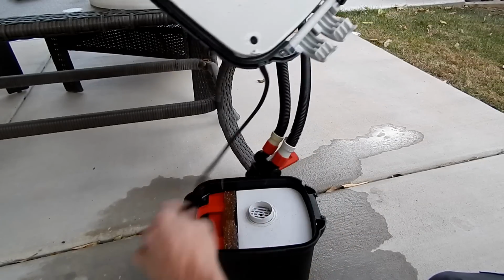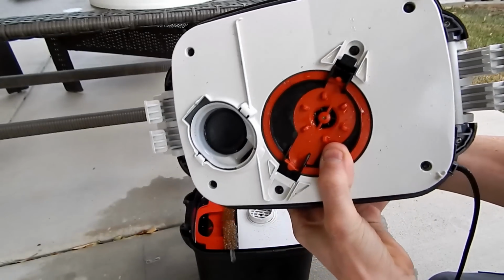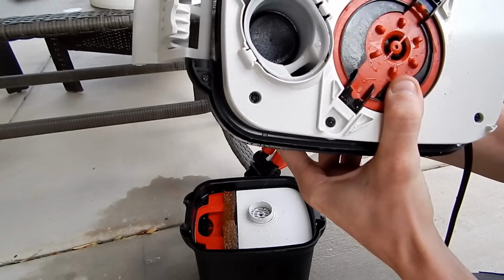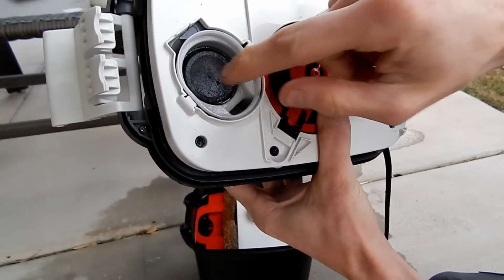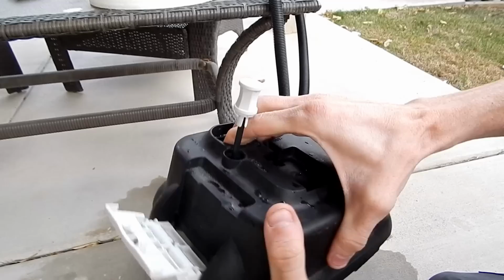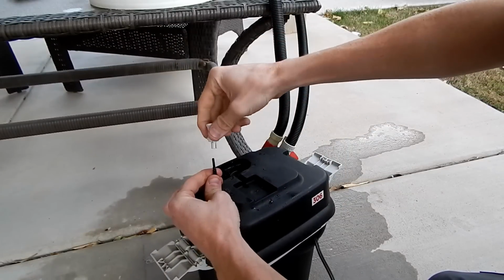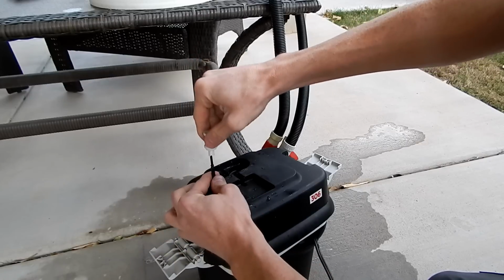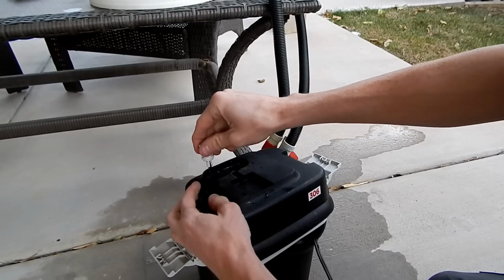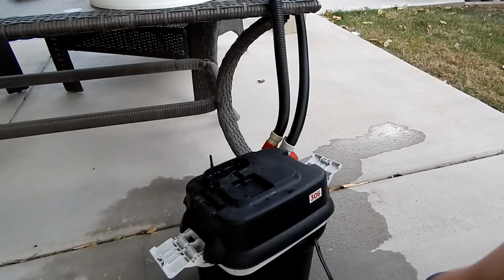I'm going to show you inside of the primer assembly. All it is, is a cylinder and a plastic piston. And that is it. I have taken this off before, or actually, let me show you how. Let's go all the way in. So with the knob, pull it up and very, very gently work it off of the shaft without breaking the shaft. So I find where the strip is there, or the slit, twist it just a little bit, kind of applying pressure that way, not the shaft itself, holding the shaft, but pushing this back a little bit, and it came right off. So that I'm going to set aside.